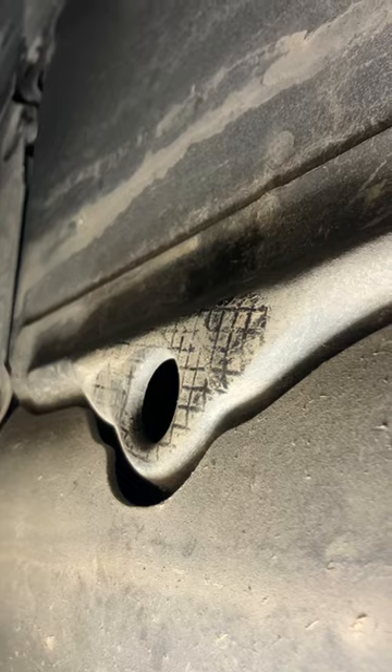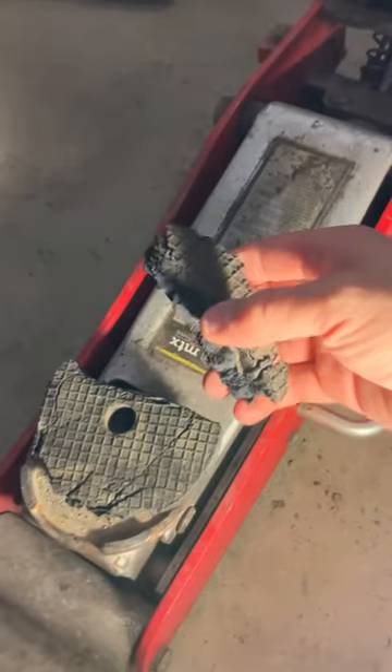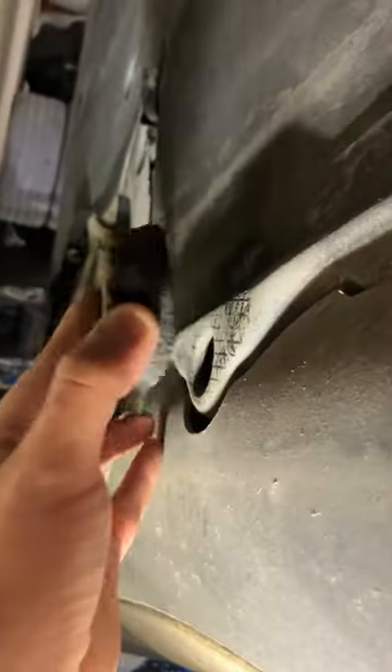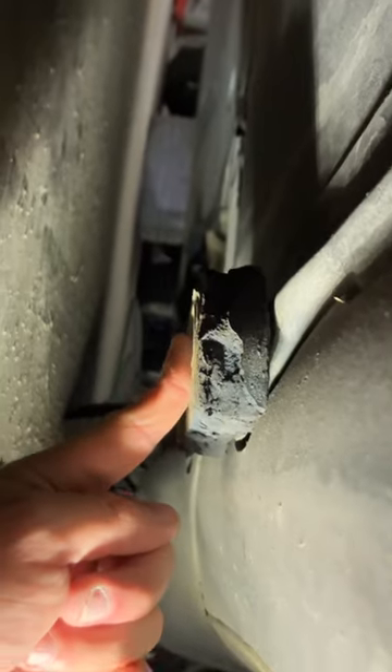If you have to choose, of course break the plastic rather than the battery. Here is the lifting frame for the car. What I've done — I had just a regular lifting pad, it was already a little bit broken, so I took this piece apart. It actually fitted even better without it. Put your jack under the lifting spot and you can use a wood or metal piece — anything you want — just make sure it's hitting the lifting spot, not the plastic, not the battery.